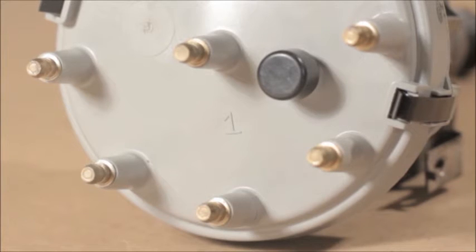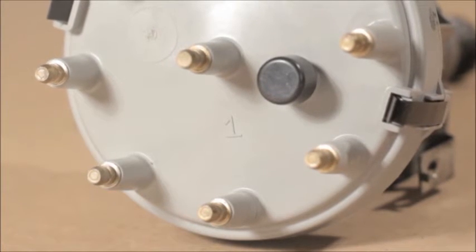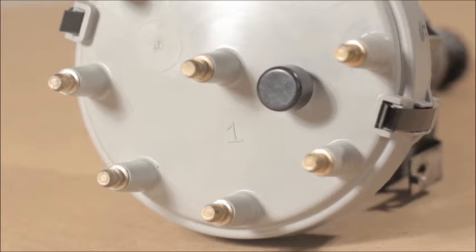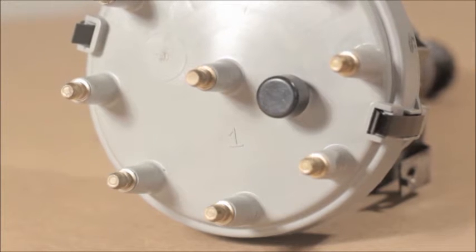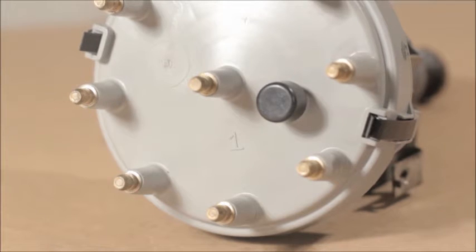What's really scary is that these companies sell fuel injection systems too. Not to worry, one of the cool things about the Pro-M EFI processor is that it can take the awful signal generated by these poor quality distributors and average it out and deliver consistent spark to all of the cylinders. The consistency of the advance delivered to the cylinders with the Pro-M EFI system actually rivals that of a high data rate coil-on plug system.